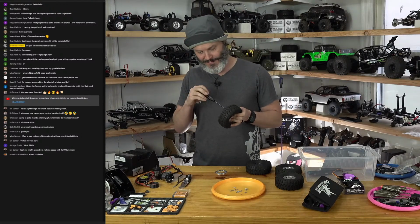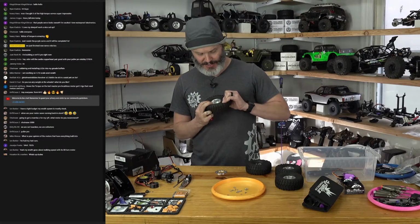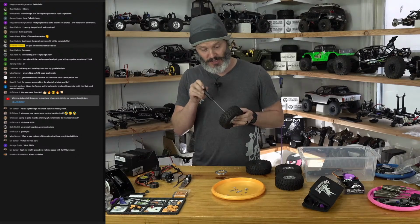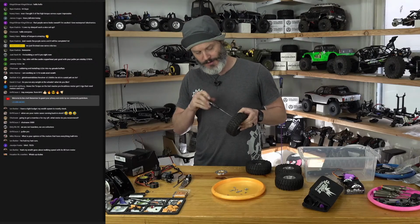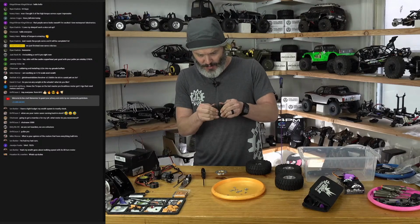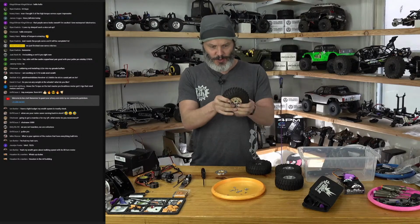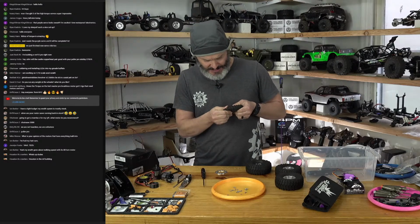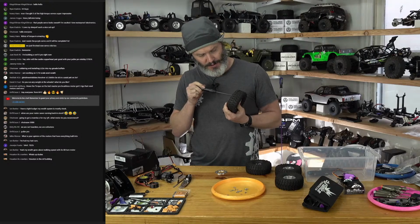And while we're distracting you, Chainsaw's asking a question. He says he's going to get the Mamba X for his Rift. What motor do you recommend? Well, a 2100 or 2200 Puller Pro R from my catalog would be the one. You want a lot of motor. Essentially, the Rift is a fast rig, and any fast rig you want as much motor as you can cram into it. So that's what I would use for a sane setup. For a not so sane setup, I would bump up to a 2700 kV in that same Puller Pro R.